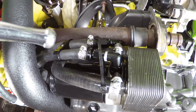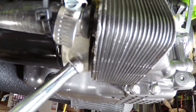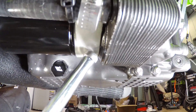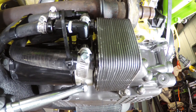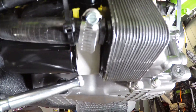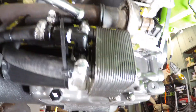There's already a factory way that it's trying to cool the oil, but I wanted to cool it even more, just because heat is a big issue. So I added on this adapter from Summit Racing — you can get them in other places — but this screws on to your cooler just like your filter would. Essentially it's an adapter, so the filter still screws on as normal, but we have this plate now in between. And what it has is two fittings with oil flowing in and out of that adapter plate.